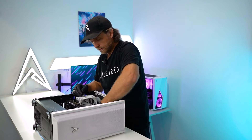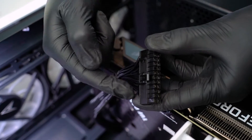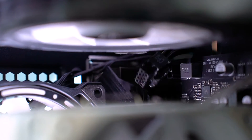Now you want to go and release the motherboard. There's a clip on the side of the motherboard just like on the graphics card — push it in and wiggle the 24-pin side to side and it'll slowly release. Then you want to do the CPU. This one's tricky to get your hands in; it might be easier to go in from the underside.